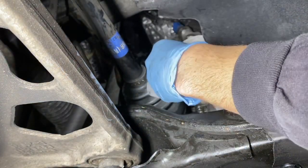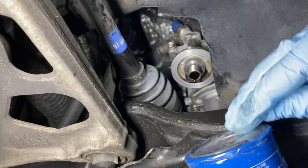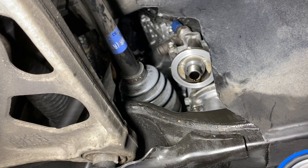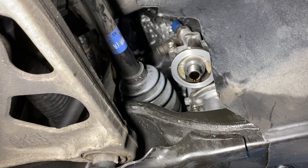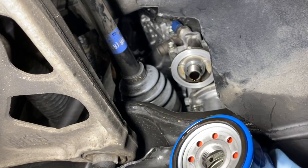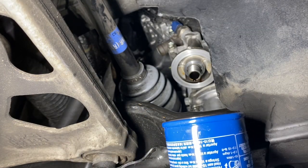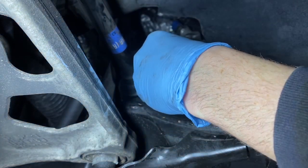Just doing a final wipe down, then I'm going to get the new filter ready to go. The new filter has a silicone cover over it just to keep debris out so we know it's clean. Now I'm going to dip this gasket into some oil — the oil pan's right here below me. You can see it's shiny now; I just want some oil around that gasket to help it seat a little better. I'm not going to pre-fill this with oil because it makes too much of a mess trying to get it up there, and I don't think pre-filling it is necessary.